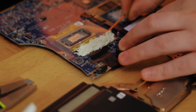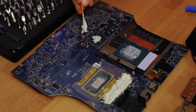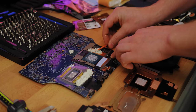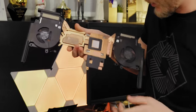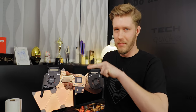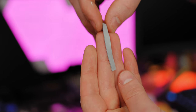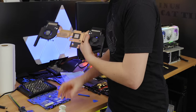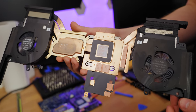The other benefit is that it can actually stop condensation from forming. Now, why should this stuff be better than a thermal pad? This copper, although it may look fairly smooth, on a microscopic level is a whole bunch of little hills and valleys. And that's what your thermal interface needs to get rid of. A thermal pad gets you about 60% contact on the surface, whereas the K5 Pro is able to fill in 99% of all of those hills and valleys.